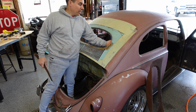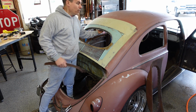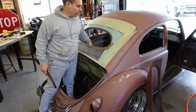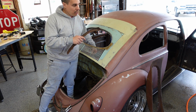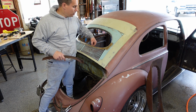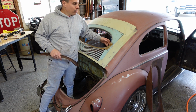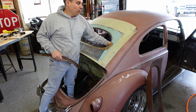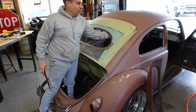Also on the inside, on the inner roof structure, wherever that's going to plug weld up to, I've ground the surface down to bare metal, so I have a clean welding area. So let's get that fitted in. I'm going to clamp it to this flange here, plug weld this first, then after it's fully attached to this flange, I'll plug weld this outer section to the inside.